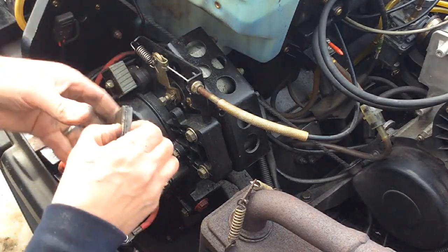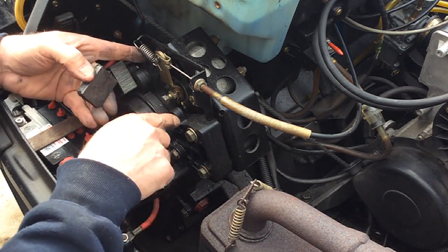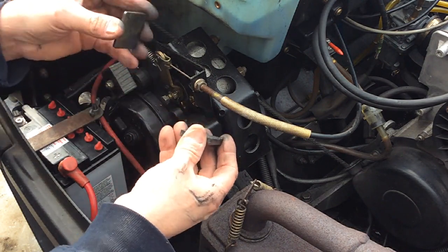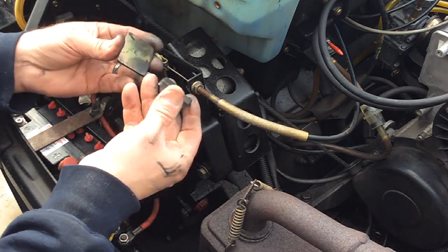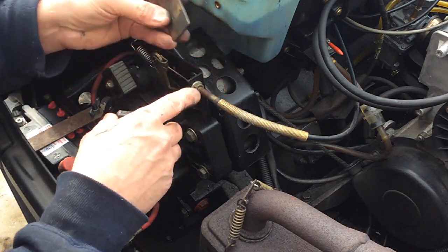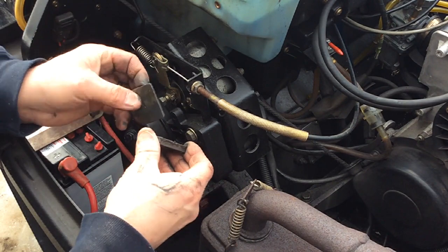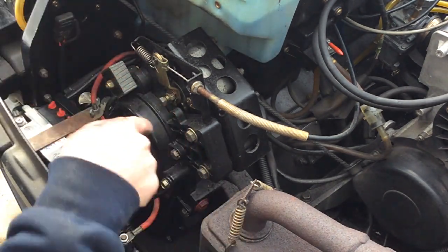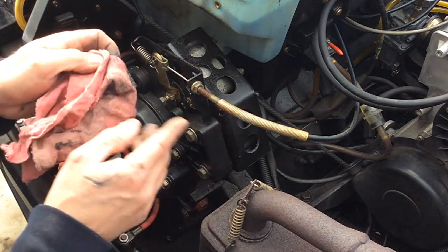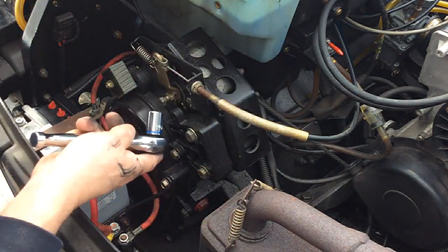What we're going to do is take this bolt here out and just loosen this one up. Last time I did this I was able to just flip this up, and here are the components that fell out of it. I probably could just put the old pad back in, but you definitely want this piece of metal — this is what goes up against the nut to adjust it. Let's go ahead and loosen this one up, take it out, and loosen this one up but leave it in so we can just flop this forward. You're going to need a 14 millimeter on each side.